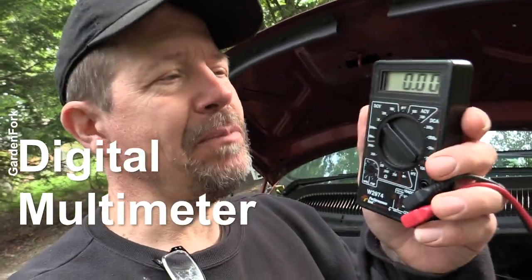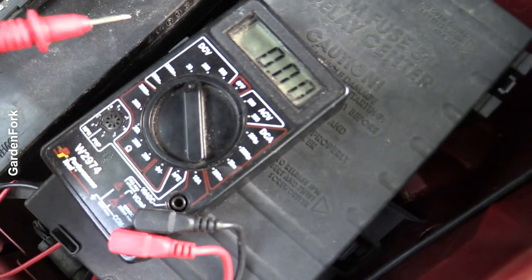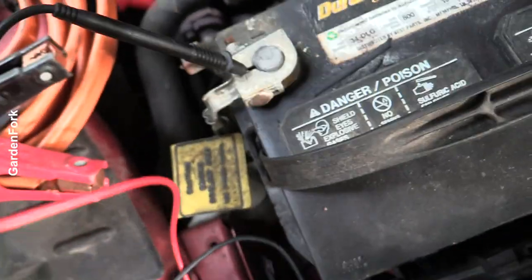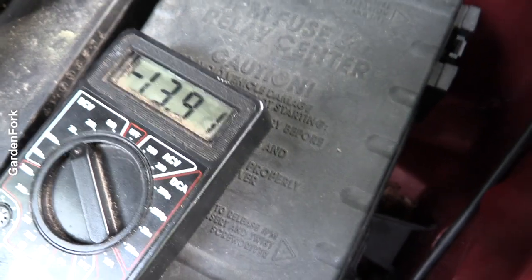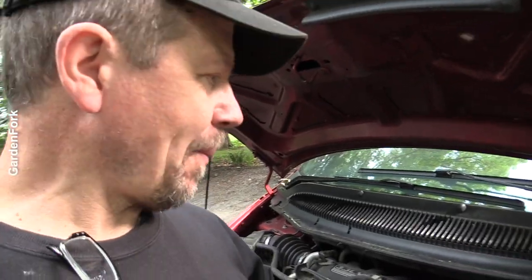Pick up a digital multimeter — this measures volts and ohms, inexpensive, and it allows you to do electrical projects. You can trace wires in your home back to the circuit breaker. Very handy. I've got this set for DC low voltage at 20. Black goes to black — touch the red to the terminal: 13.9 volts. Wow. So what this tells us is that the alternator is putting out almost 14 volts. You want 13.5 to 14 volts, which means the alternator is putting out sufficient current.